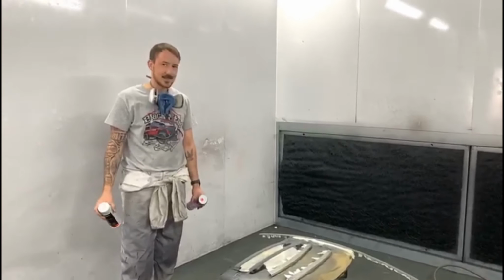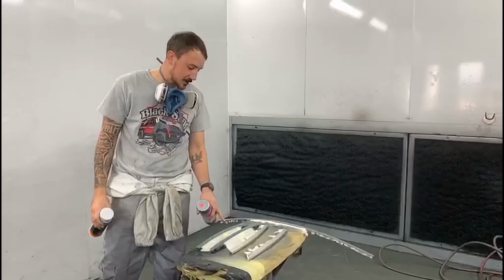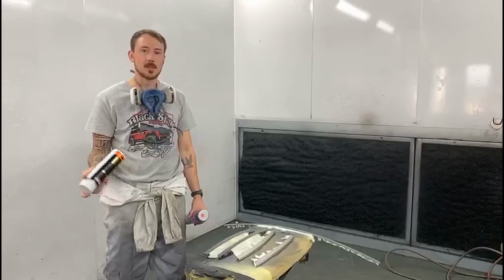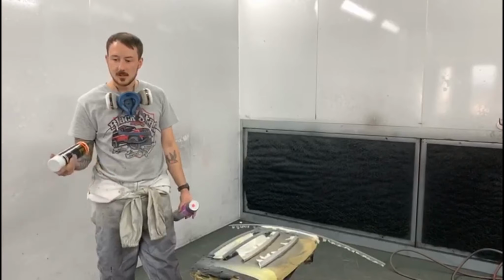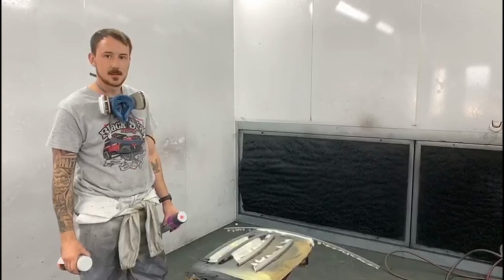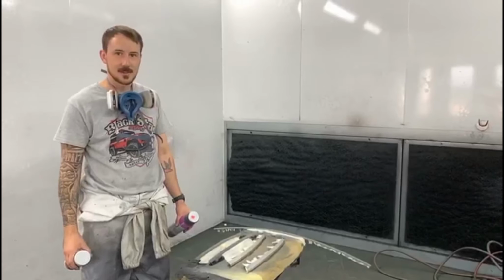And what are you now about to do, Young Fraser? With the plastic parts, we're going to put some plastic primer on them to make sure that the primer sticks. And with the chrome parts, we're going to put some etch primer on them to make sure the primer sticks. Then we're going to get them primed. Once they're dry, we can rub them down and then get them painted. Fantastic. So then paint and lacquer after that. Yeah, that'd be really good. Superb. Lovely job. Carry on, sir. Thank you very much.